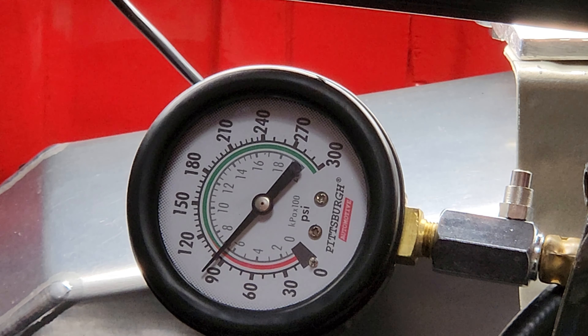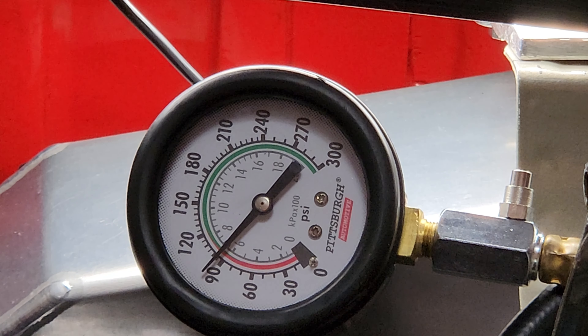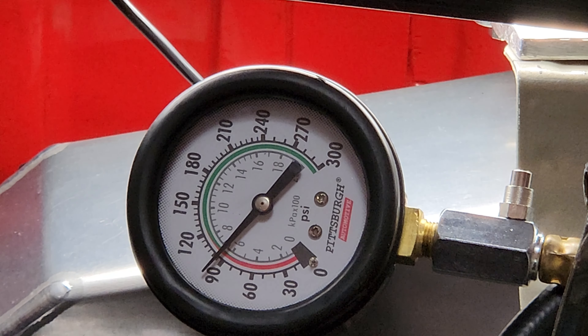To be honest, that's a little low - at least what I would think, that's probably a little low. If I was to do this after everything had warmed up, it'd probably be a little bit higher. But I would expect that with Total Seal rings, even if we have a problem, we probably are still going to get some compression. That's definitely got me a little bit baffled - just not so sure on what's going on. A hundred on all cylinders - further investigation definitely required. She's coming out, guys, because I've got to figure out why we're getting so much blow-by when getting boost. Probably Total Seal rings - probably still going to get compression even if we have an issue. More to come, and she's just coming out.